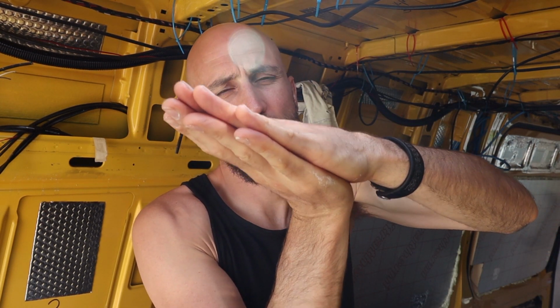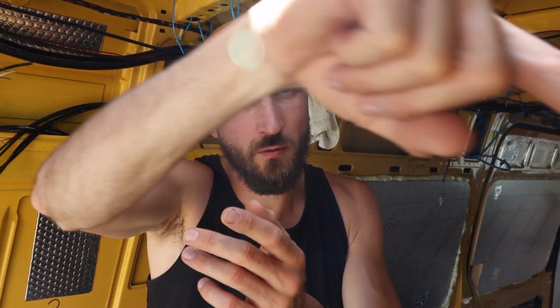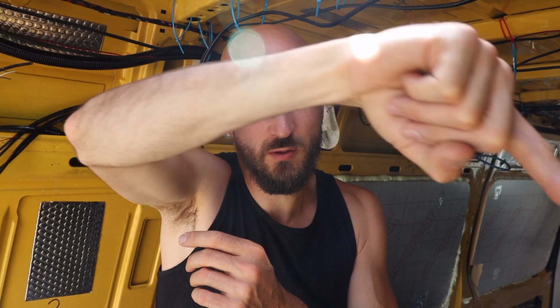Okay, so that's the Midi Heki now secured in place. Put down the butyl tape. Then before you install the roof vent, you go around and put a bead of Sikaflex around the bottom of the roof vent, then place that on top of the butyl tape, and from the inside you pull that down onto the butyl tape, and that causes a compression, and it should seal completely all the way around. And if that doesn't seal completely, if there are little holes or areas that you've missed, then you go around and seal the outside of the roof vent.